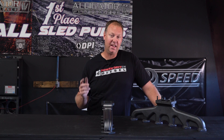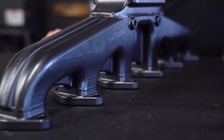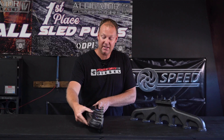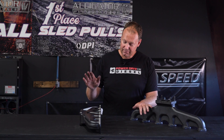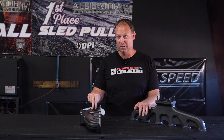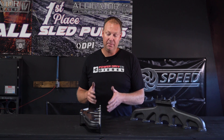He said, 'Let me think about this for a little bit and I'll get back with you.' Fast forward six, eight months — he's a very busy guy — he says, 'Hey, I got a new manifold, I'm sending it to you.' So up shows up at my door this beautiful bad boy here. We put this guy on that same head where the comp manifold was capping flow, and once again it flows more with this manifold than it does just empty. So this enhances the big, big head.